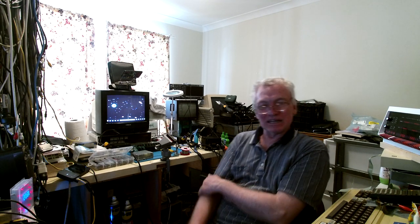My Sony monitor has been modified so it actually has RGB, and the composite is used for the sync, so that would be possible as well. But this is quite an easy way of connecting your NTSC TI 99/4A to a monitor using a MIDI cable with a female 5-pin DIN connector to two RCAs. Probably not the best way of doing it, but I didn't want to cut the MIDI cable and I don't have any spare male 5-pin DIN connectors around — just a quick easy way of getting something up and running. I hope this was some use. Thanks for watching, catch you next time, bye.